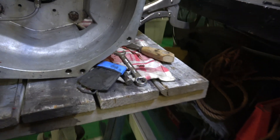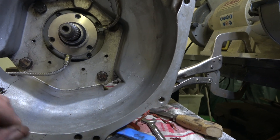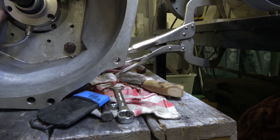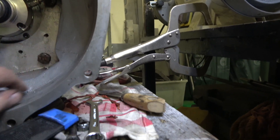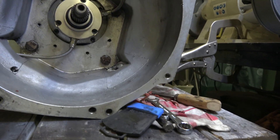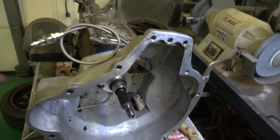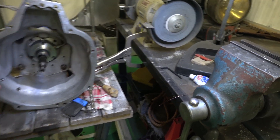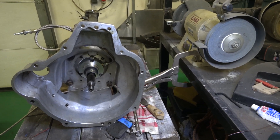I've got it all back on. That's the slave cylinder itself - I've put a 3mm packer in there to take up that space, and I'll show you what I mean. Unfortunately you can't put these hoses on before you put the bellhousing on - there's not enough room. That bolt won't go in with this in place either. This will be the feed line into the slave going to the master cylinder, and this one will be the bleed line - as close to the top as I can get it. Because of the 3mm offset it would be better if it were right on top, but it should bleed all the air out.